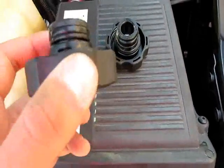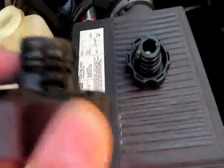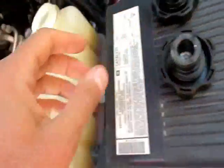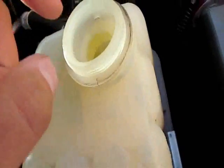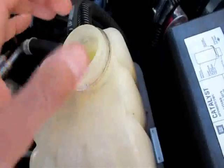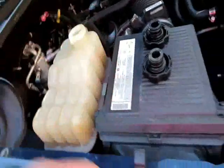I found a problem — how to change a coolant reservoir cap. Look at this rubber on the old one, and look at the new one. This one turned hard. What's happening is that O-ring sits in here, and when it gets hot it's not sealing very well, so it's barfing coolant out as vapor instead of water. I have high hopes about this fix.